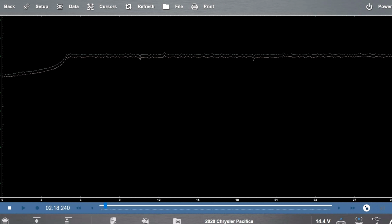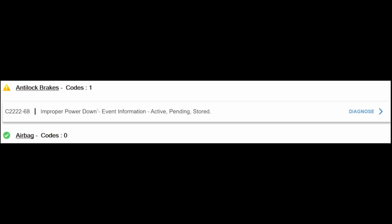So when you're doing this, just be ready for testing the small battery with the main battery disconnected, or testing the main battery connected, because they both feed each other. And a lot of times this is why the small battery goes bad, and then it will also drain out your big battery. So this is the way you test a two-part battery.